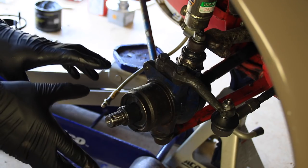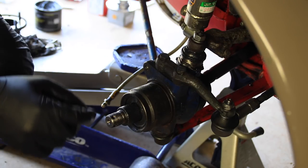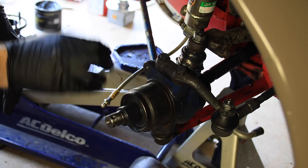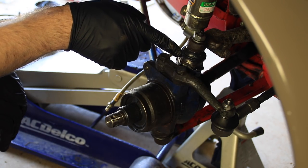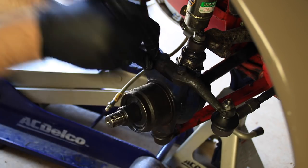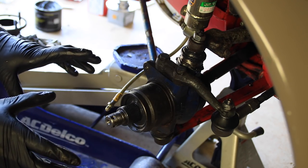After you've got your whole brake assembly off, the next thing to do is inspect everything over here to make sure that everything's in great shape. We're going to check our wheel bearings — that looks nice and solid. The next thing we're going to check is our top arm and our bottom arm here, make sure that they're good, filled with grease — and these are nice and filled. And then we're going to check our steering tie rod end over here, and that looks great as well. So everything here shouldn't require any additional work.